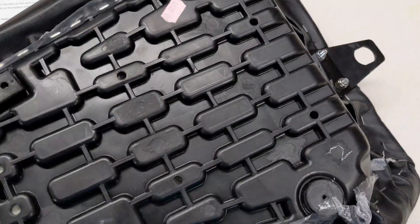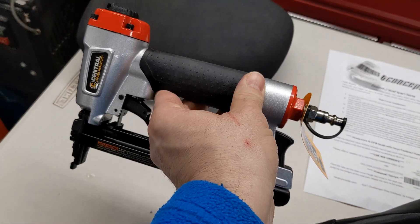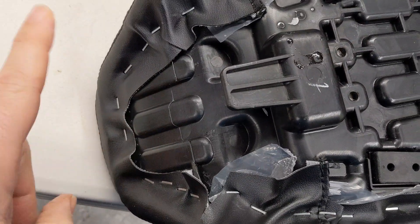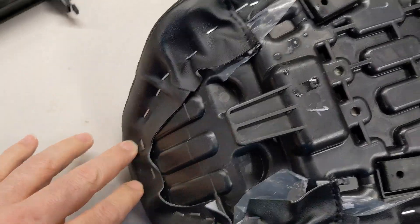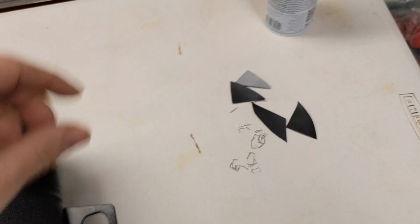There's the seat done. What they tell you to do — oh, there's the gun. I had a staple gun, but in the great Harbor Freight tradition, the staple gun I got from Harbor Freight they no longer sell staples for, so I had to buy another staple gun. Seat Concepts says start at the front, then do the back, then go side to side as you work your way back. You're constantly checking that your seam lines should be just on the outside of the seat. In one of their install videos, a guy said spray silicone underneath after you put this on. It went on with adhesive onto the foam; I just did that anyway, and then I did spray a little bit of silicone — it just helps the seat to move around.